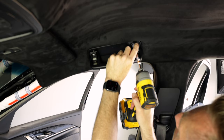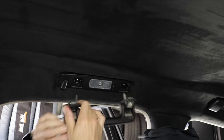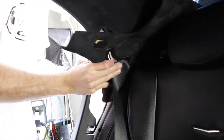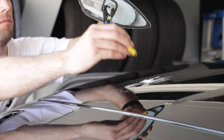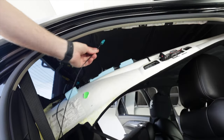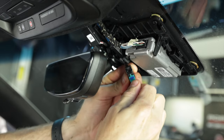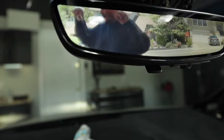Let's get started. Here are the basics in 30 seconds: we'll remove the original mirror, remove the grab handles from the front passenger, rear passenger, and rear driver's side, remove the A-pillar, B-pillar, and C-pillar from the passenger side as well as the driver's side C-pillar. Then we'll drop the headliner, swap out the old antenna for the new one with the camera, run our new wires all the way up to the front, and hang the new mirror. If it all works, we'll put it back together.